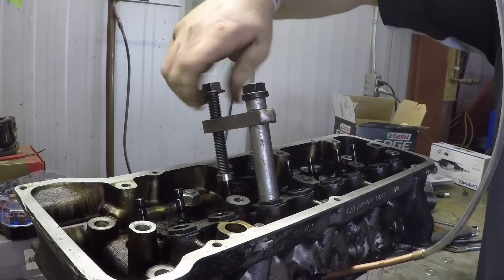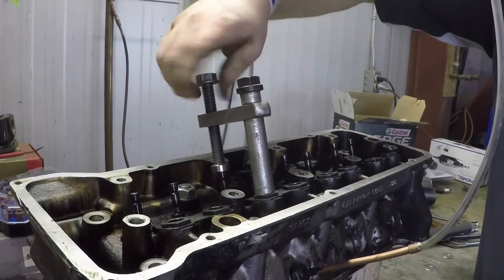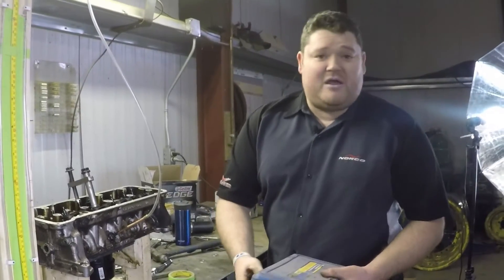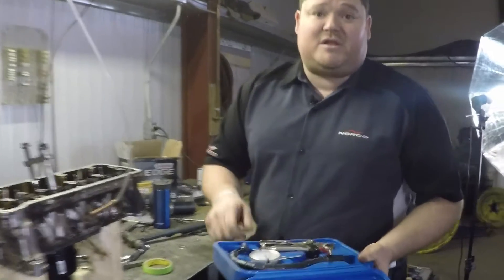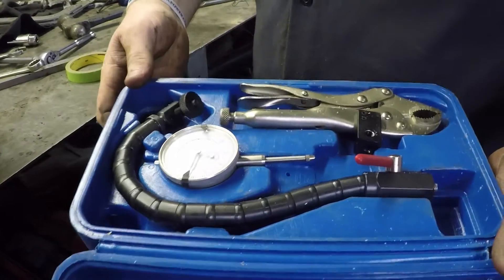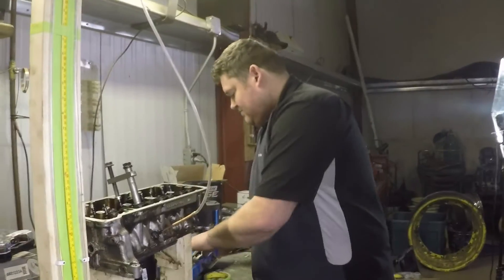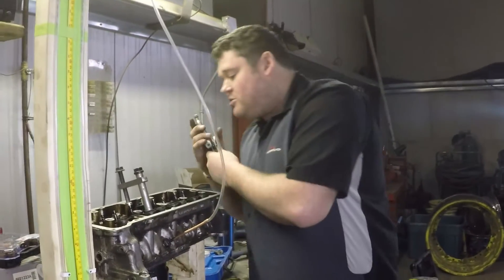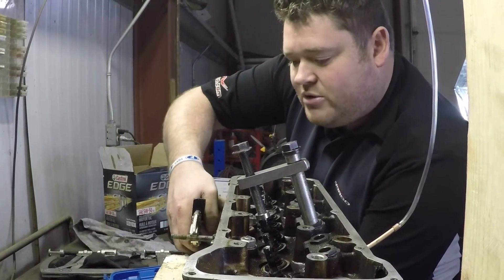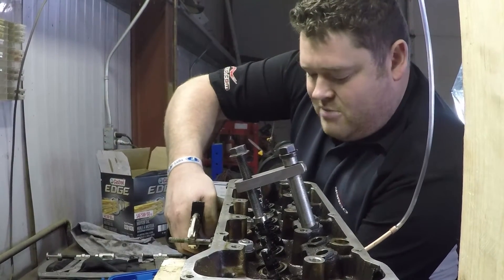That will hold it while we set whatever lift we want on our camshaft, or simulated camshaft as it were. Tighten that down so it can't go anywhere. You thread it down, it pushes the valve down; thread it up, it pulls the valve up. Then we use our dial indicator — which on the Lada has multiple uses including adjusting valves, which will be covered in a later video. Cheap kit, cost all of $25; you don't need an expensive one. It will probably go off of this stud — you always want to set up on a hard mounting point.